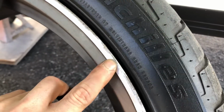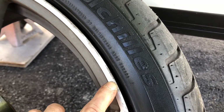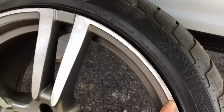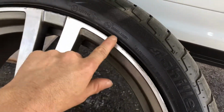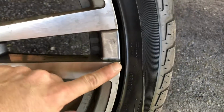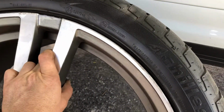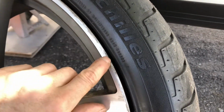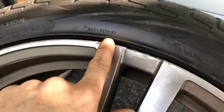This right here, don't be afraid to put a grinder to this. Get a grinder with a 40 grit disc, and it doesn't have to be a brand new disc because a used up disc is gonna work fine. If you do end up having to use a brand new disc, at least start in the areas that are the worst. Don't put a brand new 40 grit grinding disc on an area that really ain't that chewed up, because you're gonna make it worse than what it is. And because this is alloy aluminum, like most rims today, even 80 grit with an orbital sander, a DA, a dual action sander, the regular standard body shop sander, will do it. The only thing it might leave behind is little hairlines, little indentations, because it really didn't get in there, but the grinder is gonna do that for you.